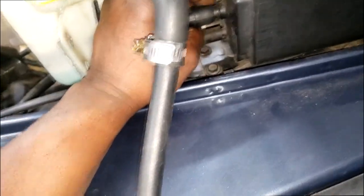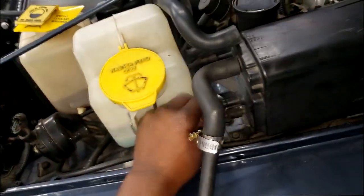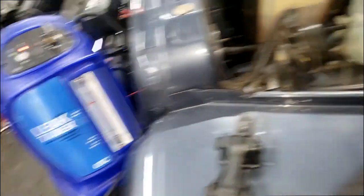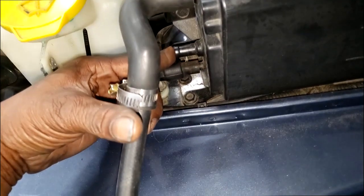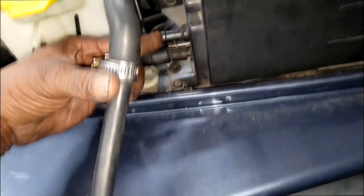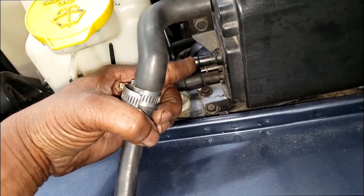Let's cut this in half guys. Let's verify if I'm leaking in the purge area — everything up front. Let's take this off and cap it off. I got this port blocked off with my finger — look at that guys, I still have a leak. In other words, my ball didn't drop, which means I either got a leak in the canister itself, or that bottom hose going to the rear. My leak is in the rear. I've basically cut this in half. Now let me reverse my hookups — put the purge hose on and remove the rear hose.